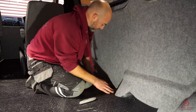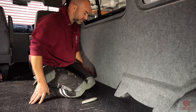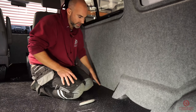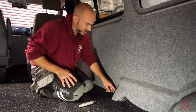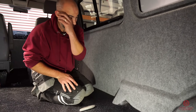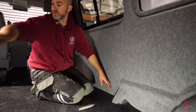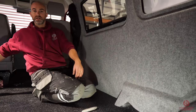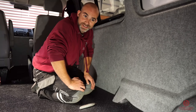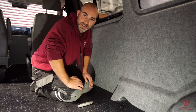Nothing is glued down yet but we're trying to reduce movement so the floor doesn't shift — that established edge is our reference point. Keep that line nice and then you can work your way round. We've now done this turn and we're going to keep going all the way round until we're happy that all the floor is fitting nicely and we're getting a nice return down at the bottom. Any questions, let me know in the comments and I'll try my hardest to answer them.